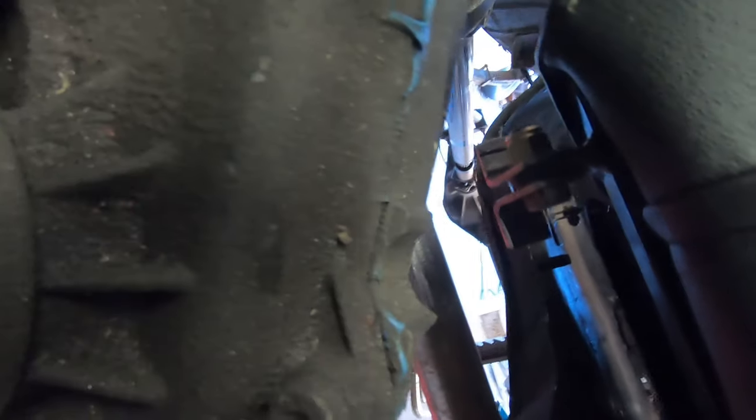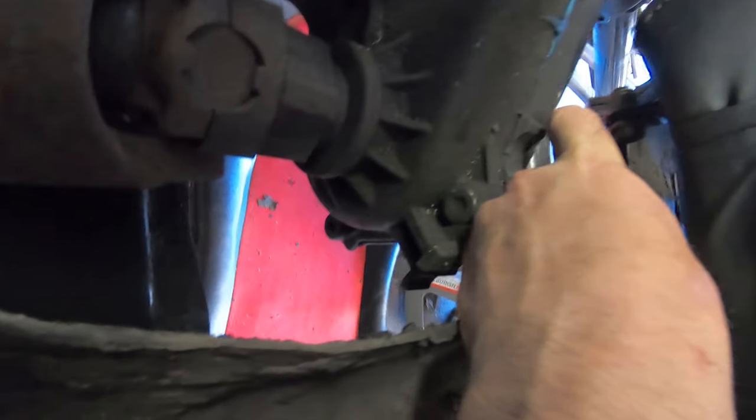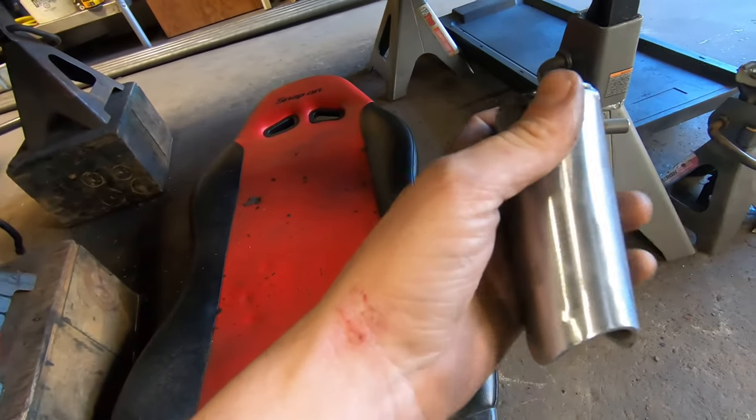The tricky part is how close we are to the transfer case — about a good inch, I can just get my hand in there. It's a very wide seat and the Cherokee is not accommodating it very nicely, but we made room. Down there are two more little angle iron tabs, and there's a bar of inch-and-three-quarter going across the frame rails on the inside, which is holding our anti-wrap bar. We're going to weld a piece of pipe up to that tab under the seat.